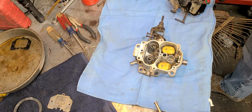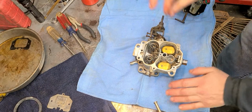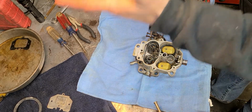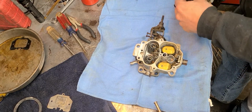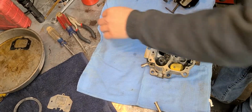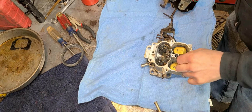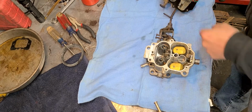I'm going to take a chance on it. Okay. Spring. Yep. Goes down there in the well for this vacuum plunger. I'm calling it a vacuum plunger, even though the vacuum's not that big of a factor on its operation. Okay. All right. Oh, one more little detail. Yes, there we are. Well, check valve goes underneath the accelerator pump.